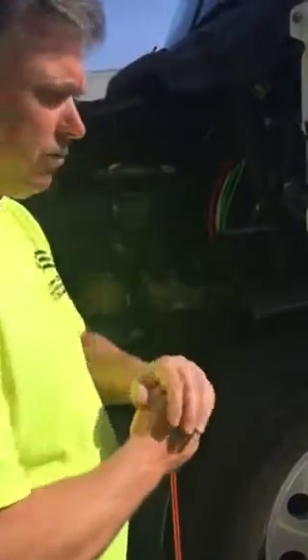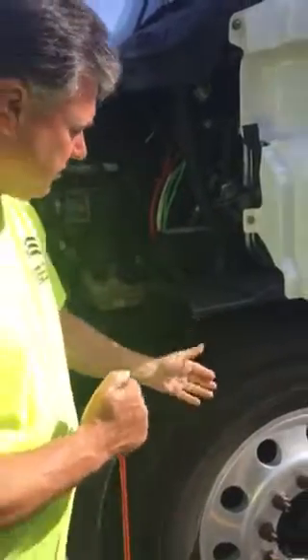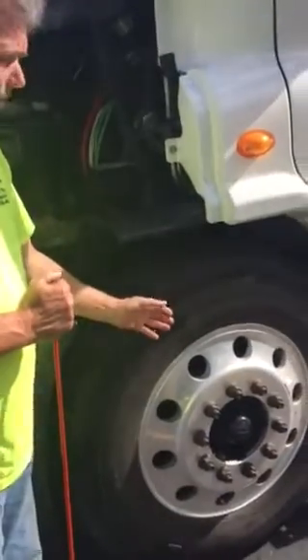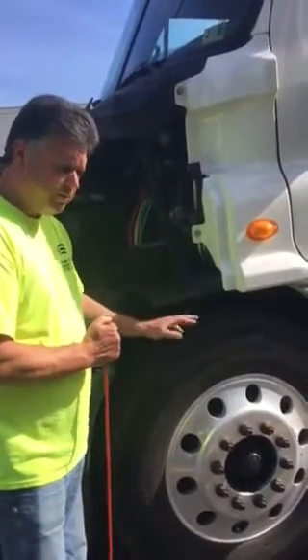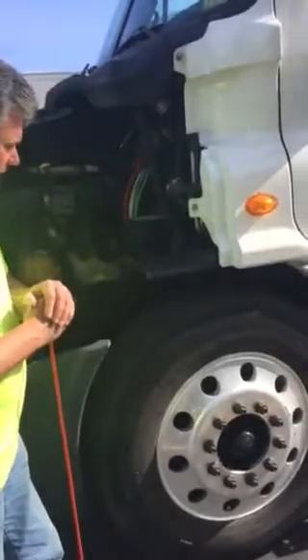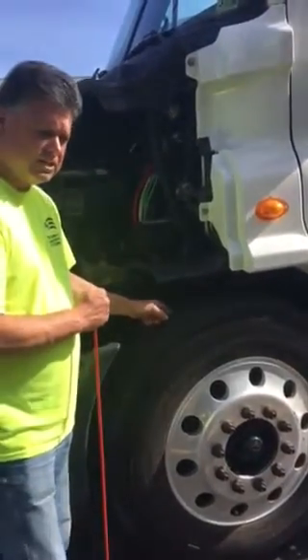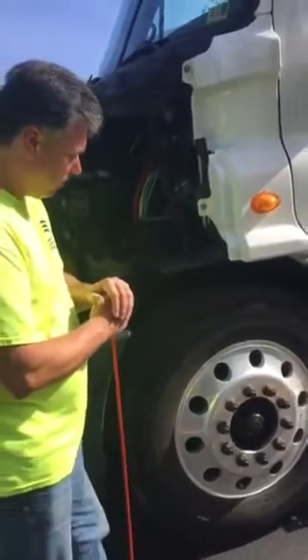From there, I'm going to move right out to my tires. There are three things that are the same on all the tires, so I always start with those. First, these tires are filled to 100 psi, which I would check with a tire pressure gauge. Second, there's no uneven tread wear. Third, my sidewalls are not cut, cracked, dry rot, or bulging. Now, these tires can have no less than 4/32nds of an inch tread depth, and these tires cannot be mismatched, retread, or recapped.